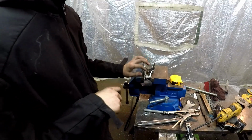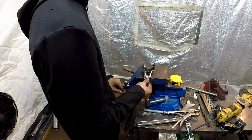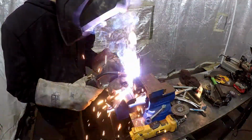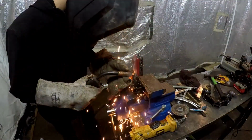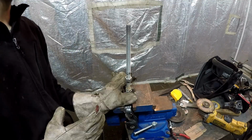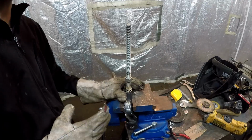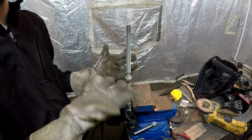So lots of wiggling later with a pair of vice grips, we got those cut off, so now our nut will fit in there, which means we can just weld that to that. So I went ahead and welded out the bottom part of the camber arm. My camera died, so I didn't capture me welding out the bottom part of the camber arm. But I went ahead and did that, so now the bar is in, and we can go ahead and cut this.